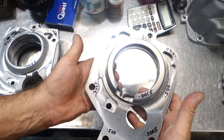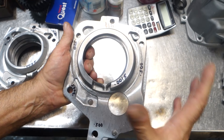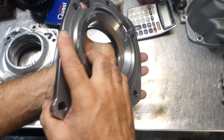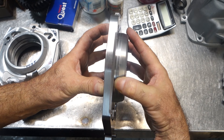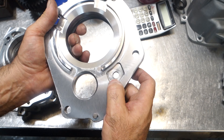This is a Super 661 plate. It's run on a Haas high-speed vertical CNC mill using probing tools that come in during each operation, so the accuracy of the plate is checked as it's being machined. The probe - called a Renishaw probe, about twenty thousand dollars with all the equipment - comes in after each operation. The plate is machined flat, flipped over on a fixture, probed and checked, then machined on the other side. This plate has a one and a half thousandths variance. It's the most accurate plate ever made out of steel. The advantage is good location front and back, solid accuracy, and you're able to bolt the countershaft to the plate under extremely high load - I torque these down to 45-50 foot-pounds when I build the units.